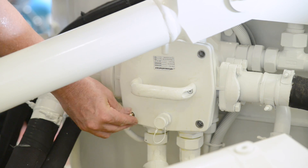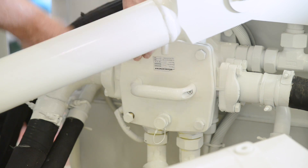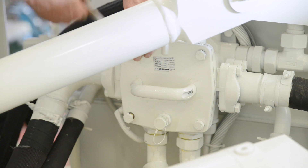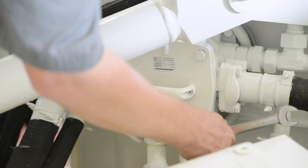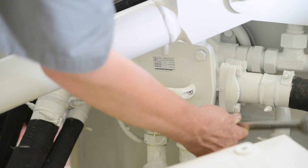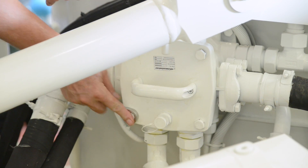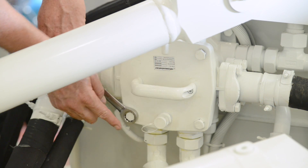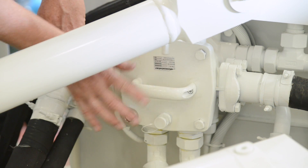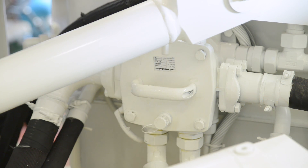The cover has been cleaned. Apply a little bit of light oil around the O-ring so that it will seal. Align the notch, give it a tap, and now reinstall all four bolts. Snug the bolts down to torque in a cross pattern — opposite corners and then opposite corners — so you don't accidentally distort the cover.